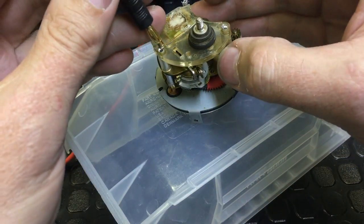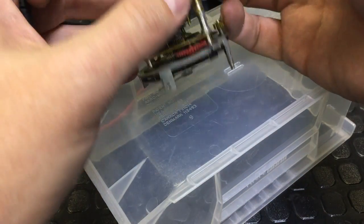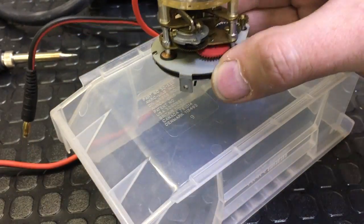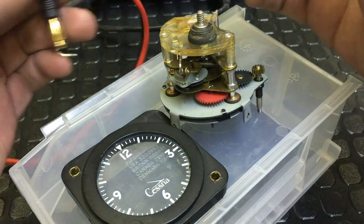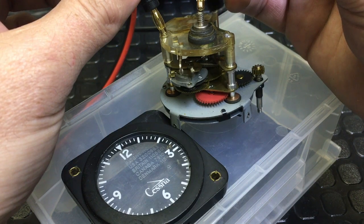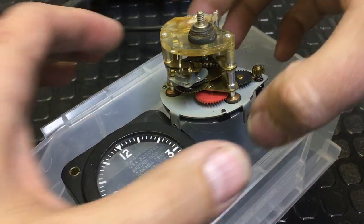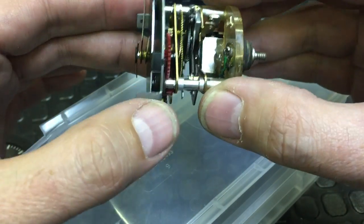I'm going to hold power to it. You can see it's starting to come back. The second hand is touching the surface. It's about to contact — and there it just reset. This will continue to happen provided there's power and the solenoid is working. So pretty cool design — I would have never guessed that's how this functions. What I'm going to do now is put it all back together, and I will have a properly functioning clock again.